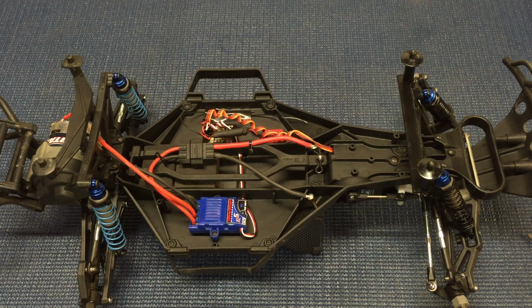If I ask you that question, is roll good for your car, is roll bad for a car? Well, it actually depends. You actually need a certain amount of roll to get the car to handle. The higher the traction, the higher the grip you have with your tires, you're going to be able to run with less roll. The car will be more reactive. You'll have traction. But if you're running on really loose conditions, really soft dirt, low traction, you actually need a little more.